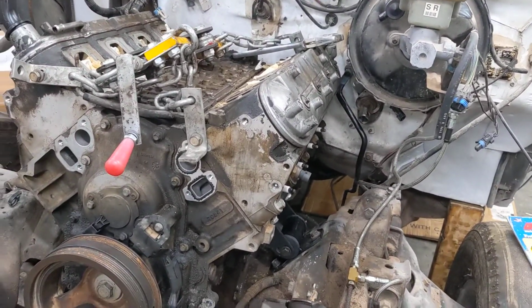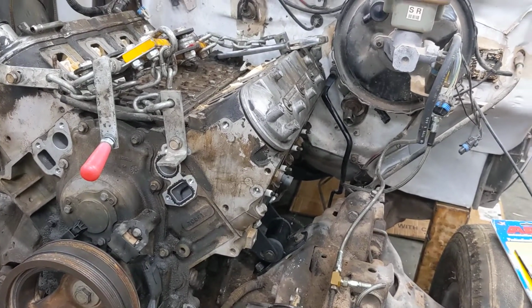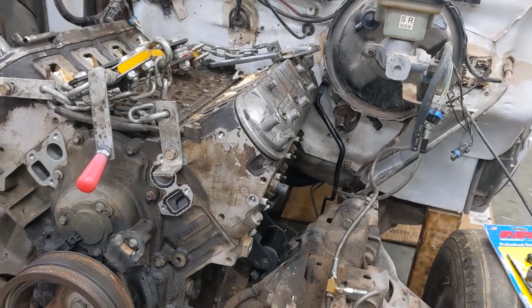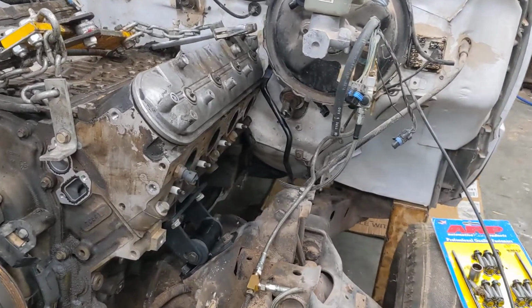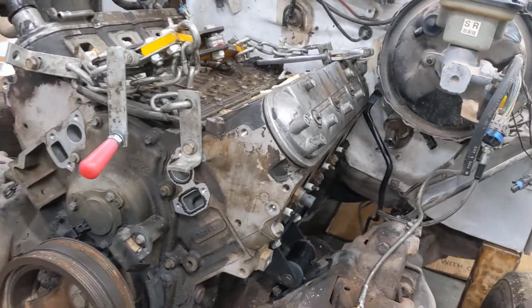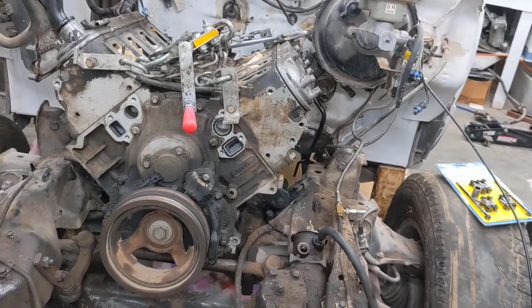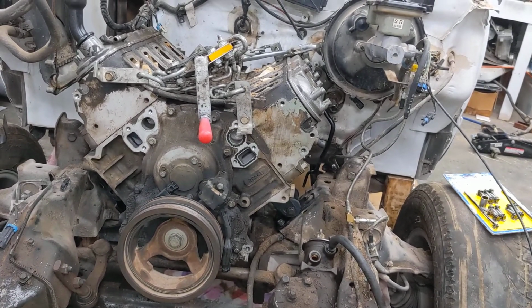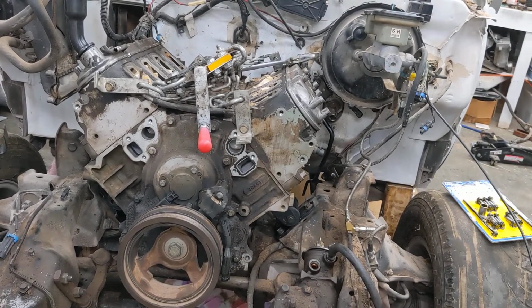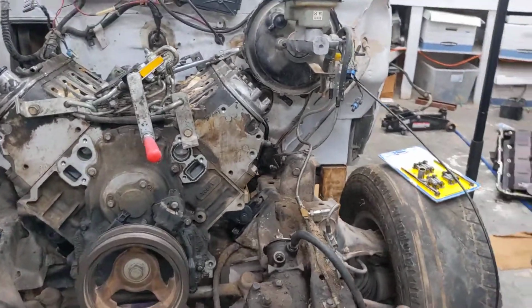So I went ahead and put in the Gen 4 4L60 and the Borg Warner with the proper transfer case adapter from a 96 to 97 Bravada that has a two-piece transfer case. If you guys didn't know, four-wheel drive transfer cases and the Bravada's all-wheel drive transfer case from the S series are clocked different. Not much, but they are different.